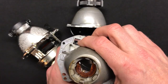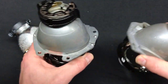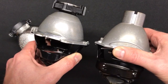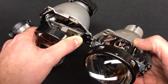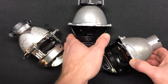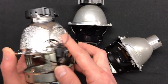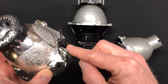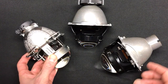In terms of where the solenoid pigtails are coming out, they're coming out the back — very similar setup on both of these. If you take a look at these two, you'll notice that the optics on the actual bowl are very similar on the outside, but on the inside they're very different. You've got some grooved options here and a very smooth bowl inside the 4.0, but similar overall dimensions on the outside. The EVO XR is more of a rounded all-around bowl, so it's a bit larger. You also have this solenoid sticking down here that you have to account for. These are things to consider when picking the best projector in terms of fitment and performance.